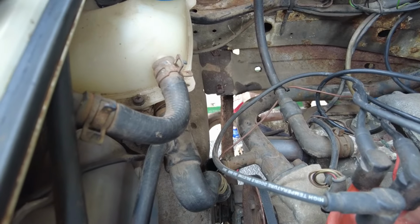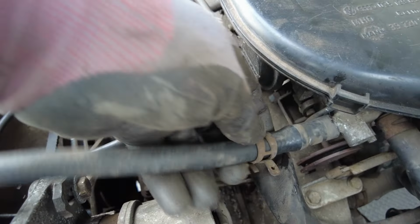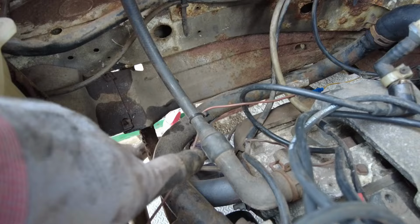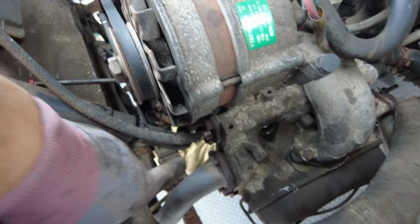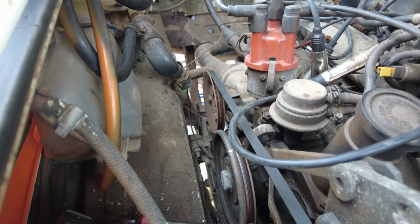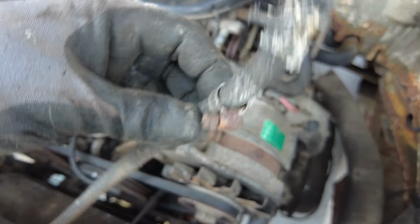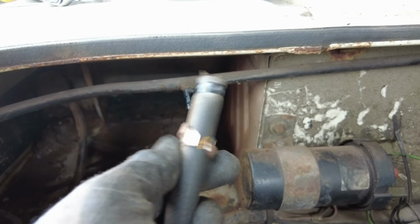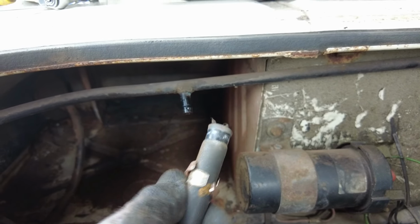And there's a water pipe which connects from your bottle all the way to here, so the carburetor or the preheater. There's a couple of pipes, goes up to here, one from the side here, up to here, then it's disconnecting. That nasty bit of braided hose definitely wants replacing. This one was crimped on, I assume, by the factory, so I've had to cut it and we'll replace it